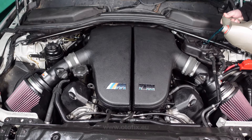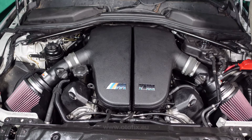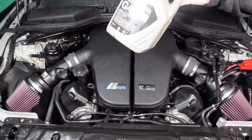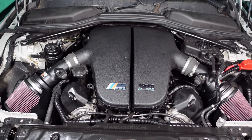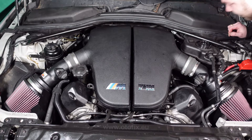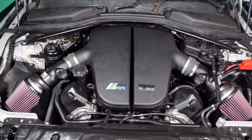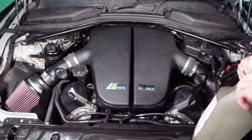So we're going to go ahead and start pouring it in. Let's hope there's no leaks. Now, this will be very, very empty. As you saw, I've drained it from the whole engine, the water pump itself, the radiator. So we are going to be re-topping it all up quickly. By the way, this is ready mix, so I don't need to add water to it. So you can see there, this has taken a whole five litre bottle — it's completely empty. Now what I'm going to do is start putting the ignition on and just put the heaters on low.